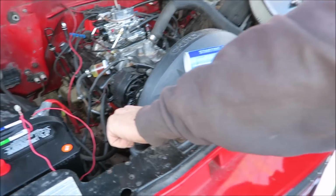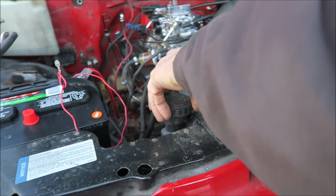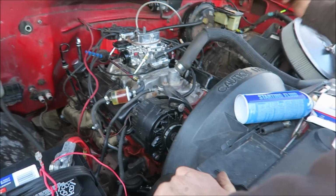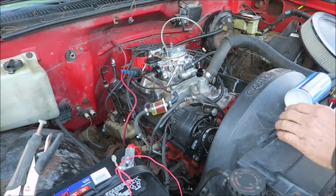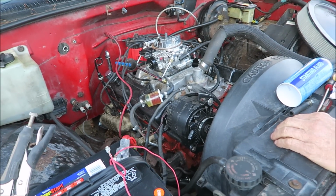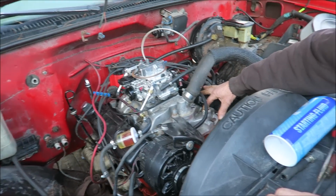Might have a gasket not holding. Because one, it's bubbling up here, which is telling me it's got a water leak. It might have. So if it's coming up, it's going in. And water mixed with oil is going to make that color. Yeah. So it might have gone head gasket. I'd say could even be an intake. Yeah. Because man, it's right there.